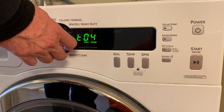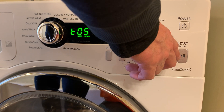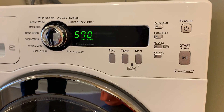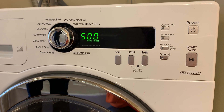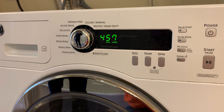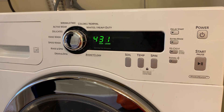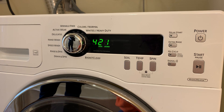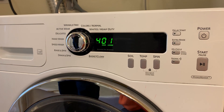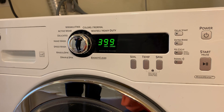Turn the knob to T5. T5 is the water level sensor test. Press Enter — there it goes, it's going to test the level sensor. Since I already tested this, I just wanted to show you — I already know that this is okay on the water level sensor.